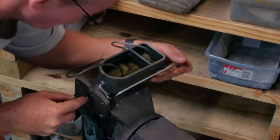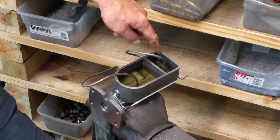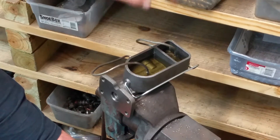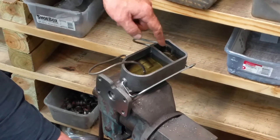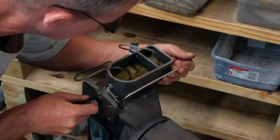Nice smooth strokes and a telltale sign — see that little geyser right there in the front pushing up? That's a really good sign that the master cylinder is working correctly, especially this front port. That's the residual check valve kicking back and then opening.